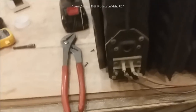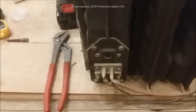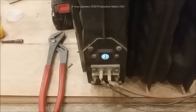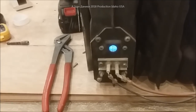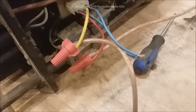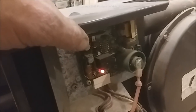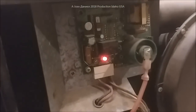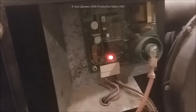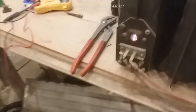It fires — about a 10 to 15 second fire. Pulling power away, which is disconnecting the thermostat wire, immediately kills the power to the board, which kills the power to the valves and closes the valve so the gas is turned off. As it sits now, we're running hot and the furnace is fully functional.